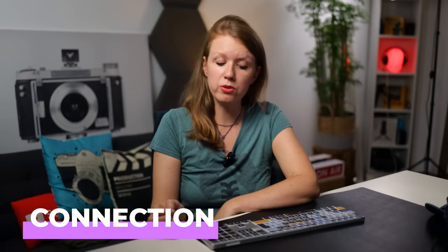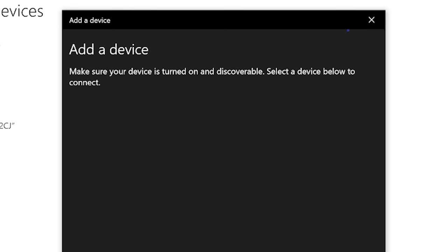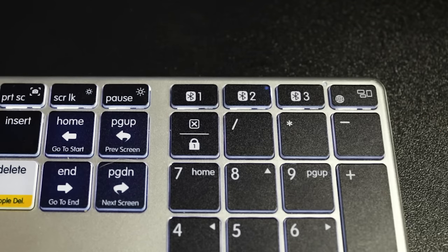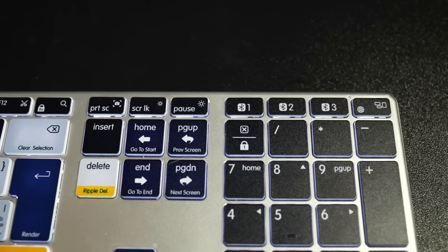To connect via Bluetooth, you'll see three Bluetooth symbols on the keys: one, two, and three. To connect to your first device, turn it on, press the one button, then go to your computer settings to connect via Bluetooth. To connect to a second device — for example, your phone — press number two, go to the Bluetooth settings on your phone, and connect it. From there, you can tap one to use your computer or two to type to your phone.